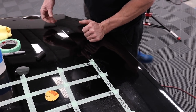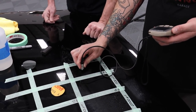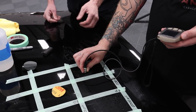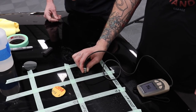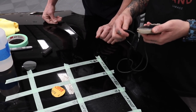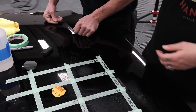What about paint swell and all that jazz about measuring? Oh yeah, it definitely has a play. Anytime you manipulate the paint, you could have possible swelling. With polishing, swelling is more prevalent because you are warming up the paint. The heat actually comes from the lower substructure on up. Did we move any? 114 now. Okay. And 118 was the lowest? Yeah. Okay. Now we'll do 1,500.